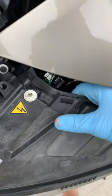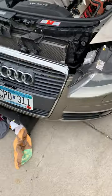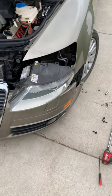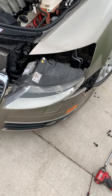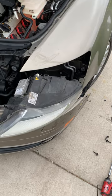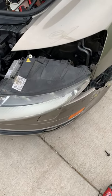First and foremost, take the fender off — the front off. There's a lot of videos on how to do that. Then you need to determine which light has the issue. All I do for that is unplug one light at a time, and either the warning will go away — that's an easy way to figure that out.